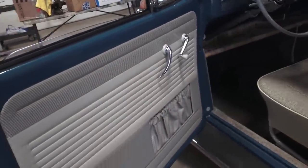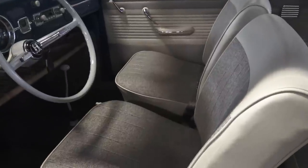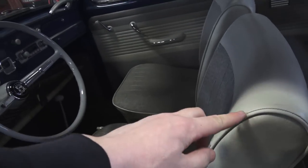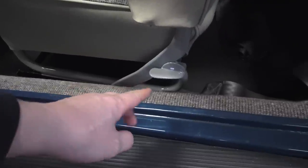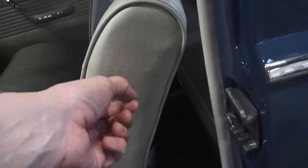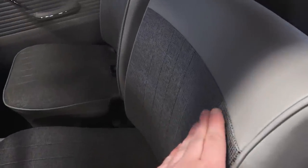This is also the year they stopped the two-tone — the last year for two-tone door panels and seats. The '64 seat was one-year only, '65 was one-year only, and '66 was one-year only. In '65 they thinned out the backrest and now the piping rolls over the backrest as opposed to coming up and going across. The seat style from '65, '66, and '67 were very similar but the mechanisms did change. This is correct for '65. We went to the exact specifications for this car and you can get this interior with TMI.